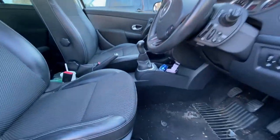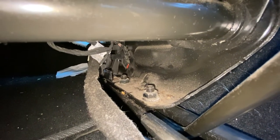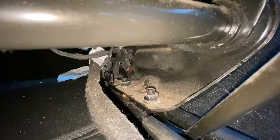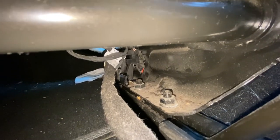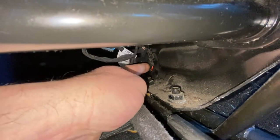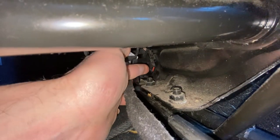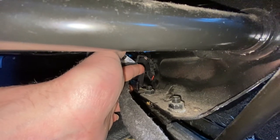So what did I do? Coming into the car underneath the seat, you can see where that red wire is just about there. On that plug — basically that's one of the seat belt pre-tensioner control cables. All I did was get in there and give it a wiggle. I didn't disconnect the battery or anything, just moved the cables around. That's literally all I had to do.